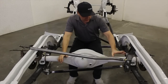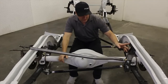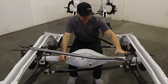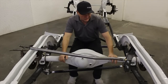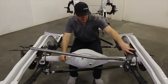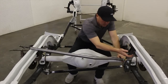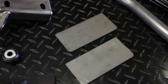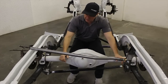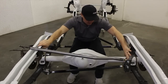We now have the passenger-side frame mount in place — in this display I've just screwed it, but essentially you're going to weld it. Some people ask about continuous weld versus stitch weld. On a thin frame rail, because this mount is really heavy, I would probably stitch weld it: one inch, then a little gap of about a quarter inch, then one inch again, going all the way around. The additional flat plate goes on the back side. The next piece is the crossbar, which is essentially the frame-to-frame support to tie in and secure this particular side.